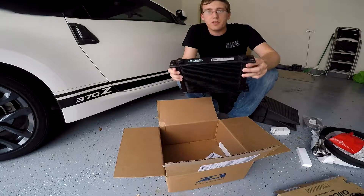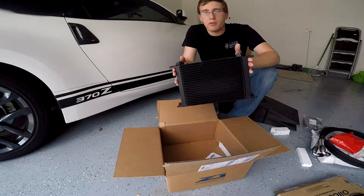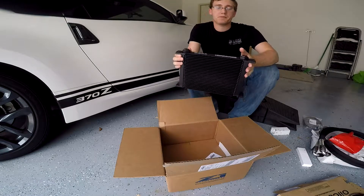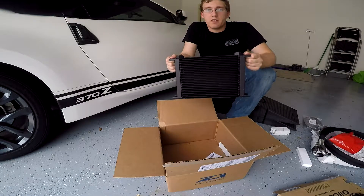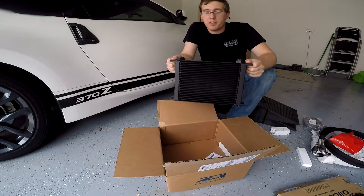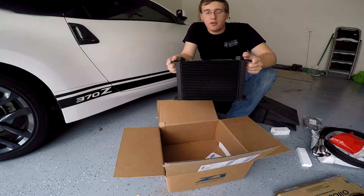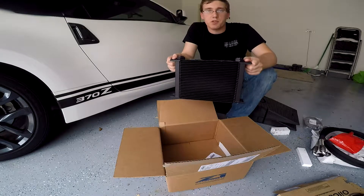This acts very similar to the radiator in your car that's used to cool the engine, but this runs oil through the actual cooler and allows it to mediate the temperature. I have specifically gone with the 25-row oil cooler because it is the largest oil cooler that will fit underneath the Stillen intakes, since I'm still planning on doing the Stillen supercharger kit. This will allow me to fit the oil cooler without having to make any modifications to the supercharger kit.